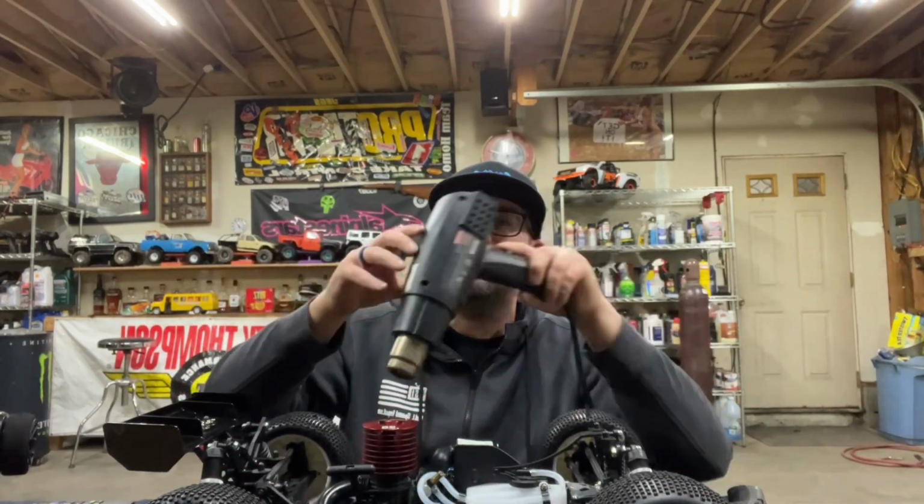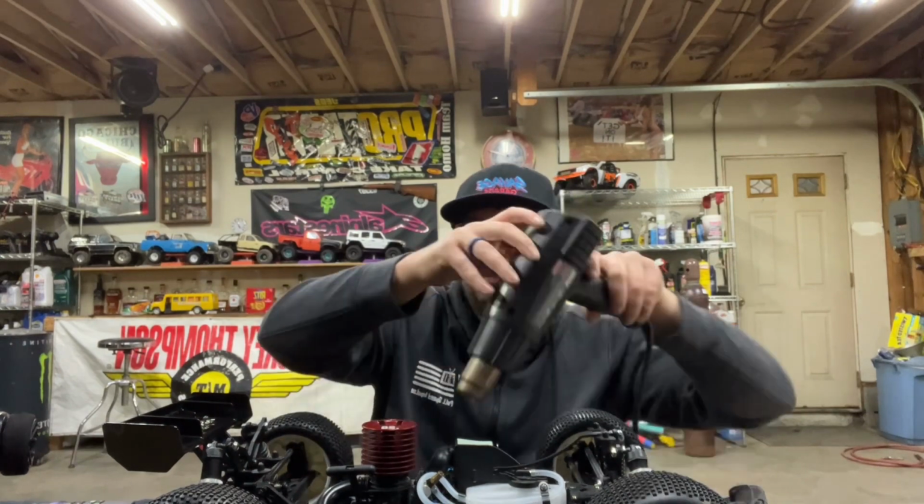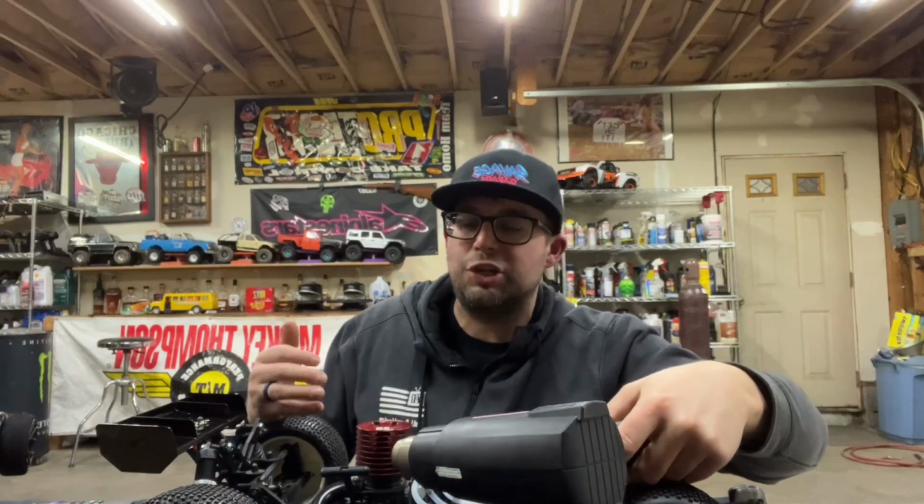All right, so another interesting thing is I see people wrapping the head on these RC cars to keep their engine hot when they're running the RC car around, just to keep the motor hot. And the reason why is because you also want to run your motor rich. And when you run your motor rich, you're also running it cool. So it's kind of fighting that process of keeping your motor hot, but you want to run it rich to keep it well lubricated. So you don't want to run it lean until you actually get the motor fully broken in and ready to rip, to where you put in that performance tune, is how they would say it.